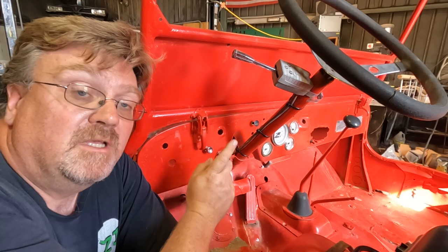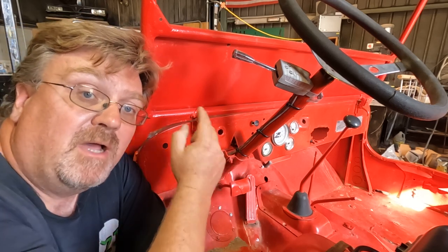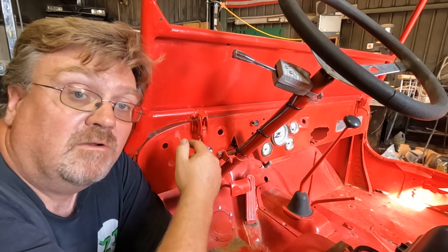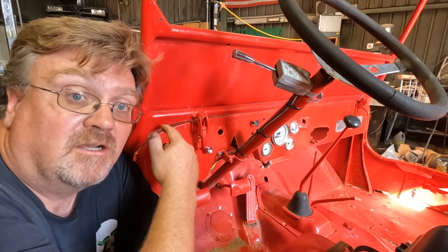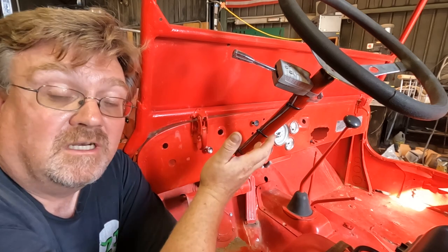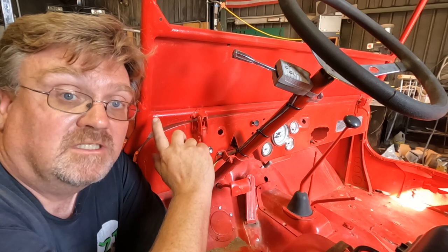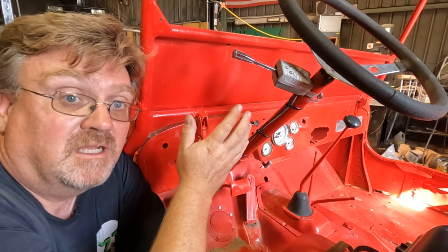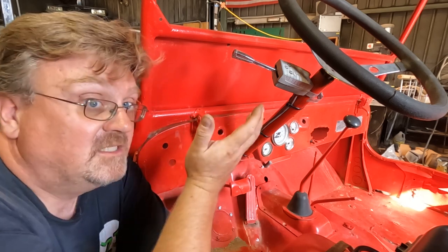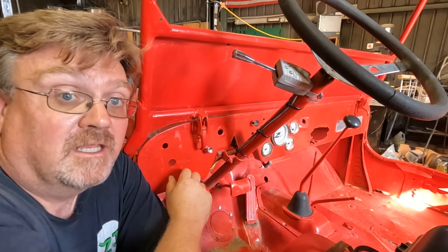The reason this is going to be a little bit of an issue is, since they're on the same circuit, when I power up the running lights with the vehicle towing this on the tow bar, it's also going to turn on the headlights. But it only matters at night when you're using running lights. And I'm only planning on using that tow bar in emergency situations, so I don't think that's going to be an issue. Worst case scenario, if it's an emergency, I can just disconnect the headlights and I'll be fine there.